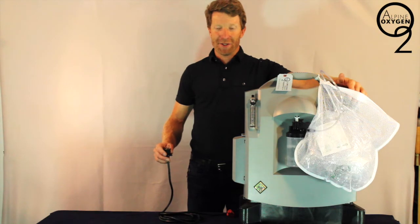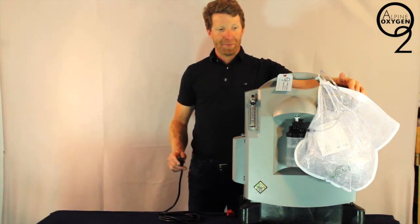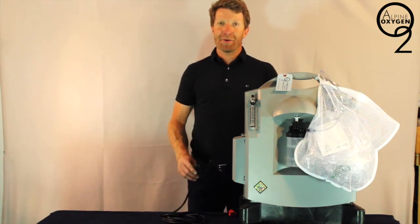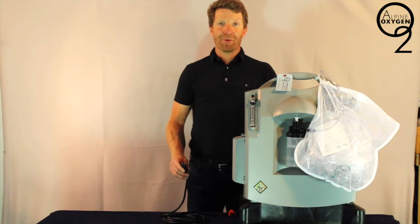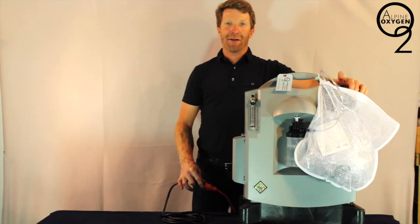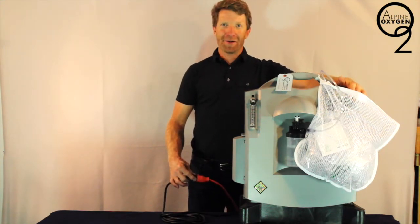If the unit is not plugged into power, or the power is not good on that outlet, when you turn the unit on, it will make a continuous audio beep. In this situation, the hotel, condo, or private residence probably has a switched outlet. Roll the whole unit across the room and plug into a different outlet that is not switched. You can then test this outlet the same way by plugging it in and turning it on. If it makes the short beep and then comes on, you know you have good power.